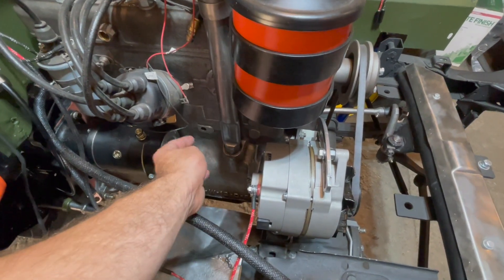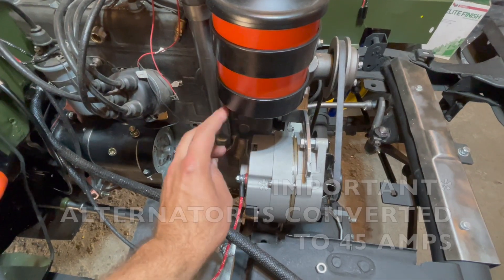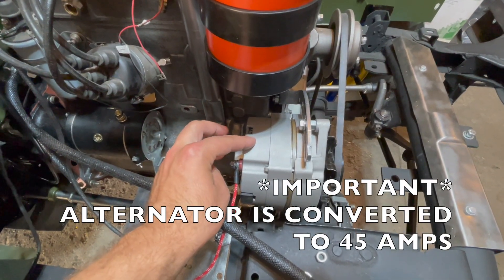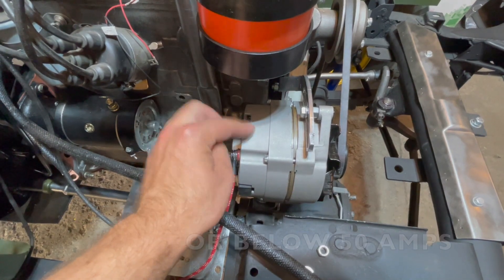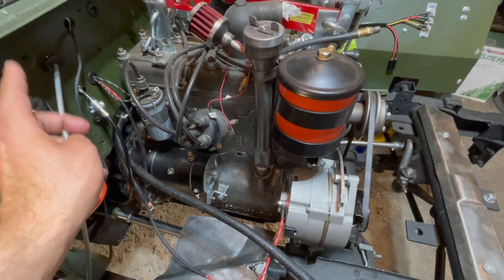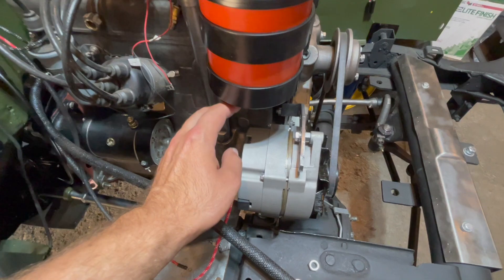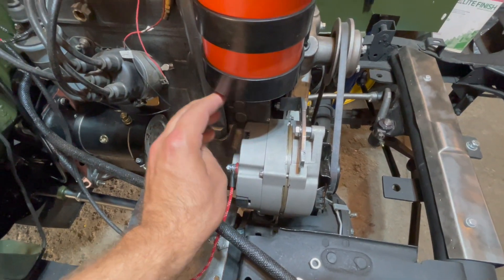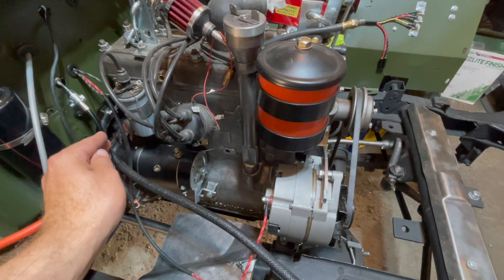Your generator would have been a 6-volt system. Your alternator is now a 12-volt system, and it's very important that we have an alternator that's been converted to 45 amps or below 50 amps, because our amp gauge on the dashboard only goes up to 50 amps maximum. You don't want your amp gauge to overheat as it might cause a fire.